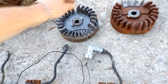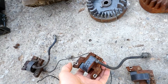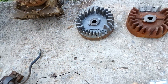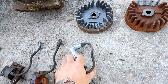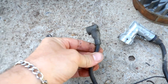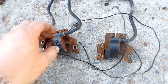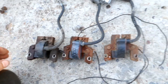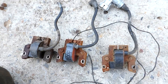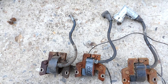You've got your flywheel here, and as I'll show, this one's a 2000 off a three and a half horse lawnmower — the right diameter, it fits on there. The only difference is on the spark plug end: you've got a little clip-on connector with a rubber cover on the older style, and then a big cover on the newer one. The magnetron or coil themselves are all the same — they'll work. Briggs may know whether they're actually identical, or whether some start better at slow speed, but all I know is you put them on the motor and it still runs.